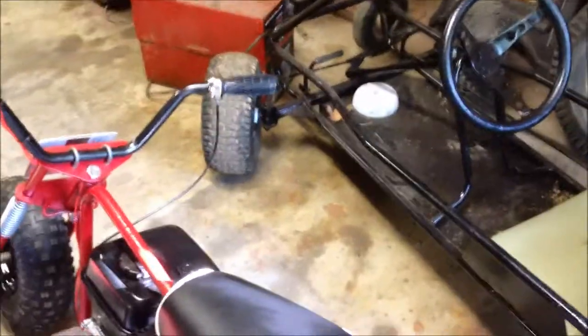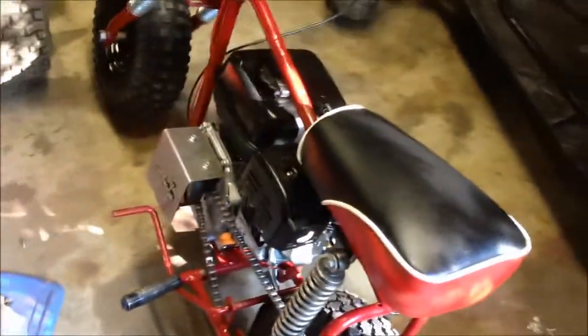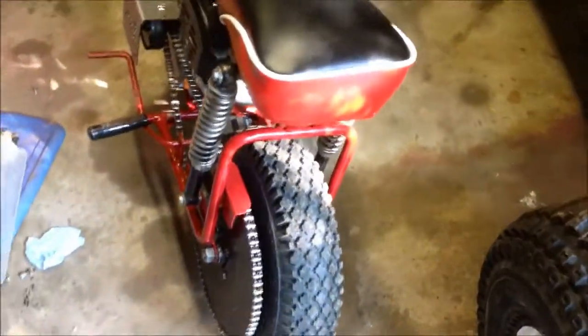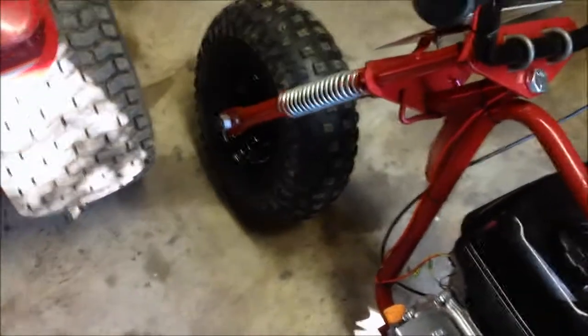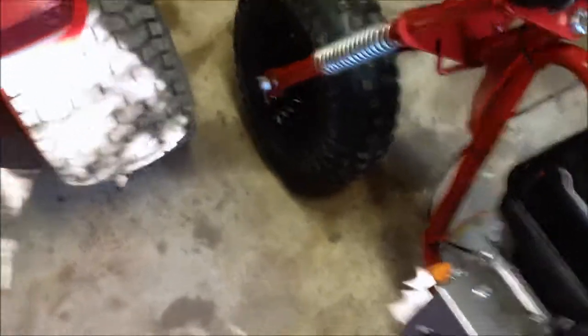It was actually a good addition to the go-kart I picked up. Now I've got a pretty fast 8-horse go-kart with that 40 series on there — it's pretty quick. I just need to get some new front tires because if you watched my last video, they were kind of splitting. I've got some knobby tires on eBay for about $71 with free shipping that I'm going to order if I can't find decent ones used. I've still got to get some bearings on the front with a snap seal. The ones without snap seals I ordered aren't quite right — they're making one of the bearings push in and the tire wants to rub. On the back I put those snap seal bearings on and they hold from getting pushed in, so that's what I need for the front.